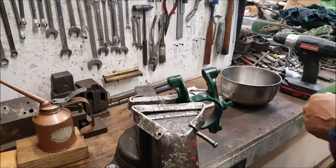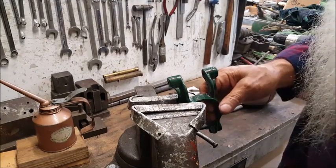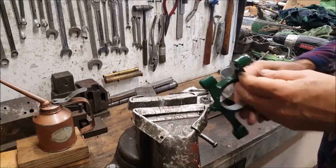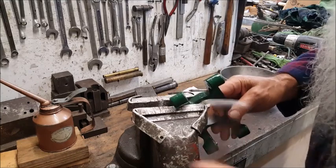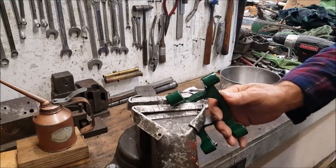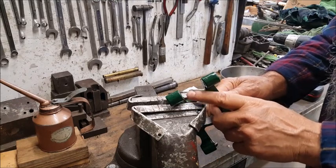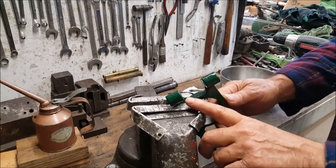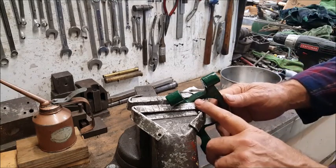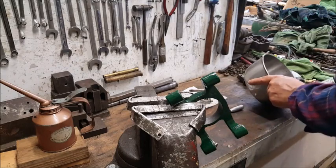And the reason for doing that is: you can crank on your engine if you want to, but if you want your engine to start when you turn that flywheel over, you have to do this. There's a little offset on that casting right there, even when they drill that hole. Well, it's not too bad — if it was any more I'd take a file to it. I may do it anyway because it ain't right.